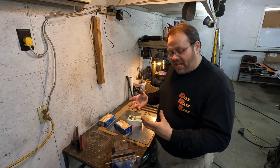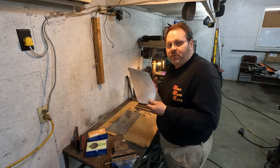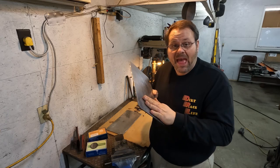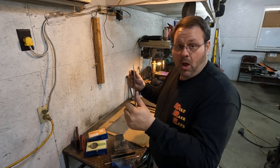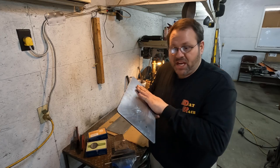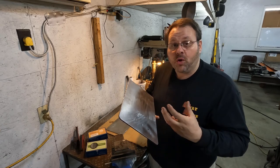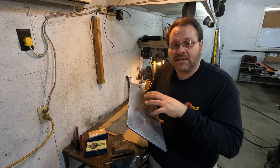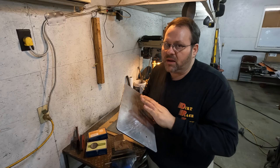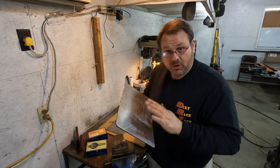You want two identical gauges - I do think it's important that it's a matched set because you have to have two of them. The critical piece is you have to have a flat plate of some kind that is going to mount onto your hub. I've got 3/16 plate steel that I've checked and made sure is perfectly flat. It can be aluminum, or I've seen guys use MDF board. The main thing is it has to be flat - it can't have gouges, grooves, any cup or twist, because that will directly throw the readings off.